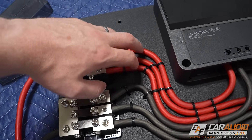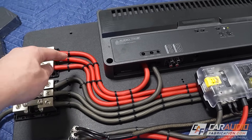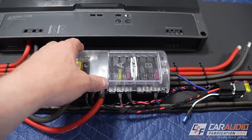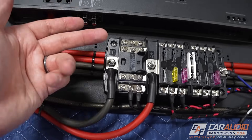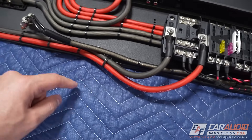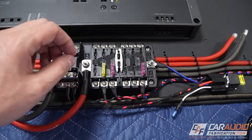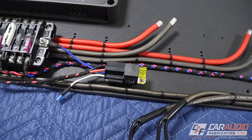Previously, each of the three power leads went to our amplifiers and the same for the three ground connections. In this case I'm only going to have two amplifiers, so we are going to get rid of one set of those connections. Now, about this smaller fuse distribution block — I've got a ground distribution block for some of the smaller ground wires, but I also have a constant 12-volt power hooked directly to the same feed coming from the battery. Then I have a switched 12-volt side that is fed power via a 30-amp relay.